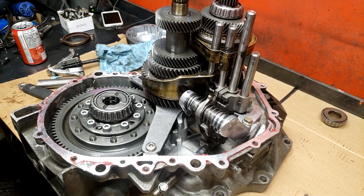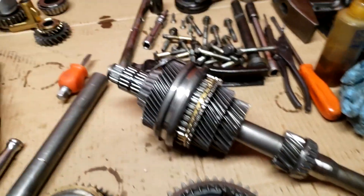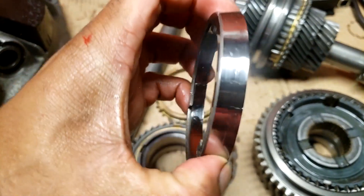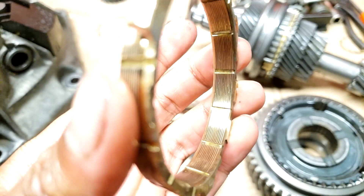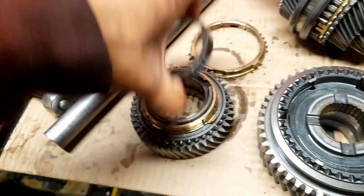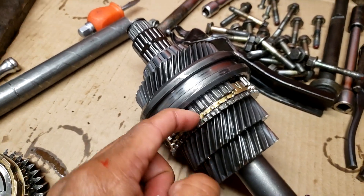So we're just building a stock gearbox basically again. That's a really worn synchro - it really owes me nothing. It's not meant for these revs, and when you have a clutch that's dragging, that's going to happen - you're just forcing it into gear racing. Second gear looks pretty good, you can see the grooves. This is the large ring, this is the intermediate ring - I'm just making up names right now. And this is the first ring - not too bad, not really depleted. This is just from jamming it into gear. The synchro is doing its job.